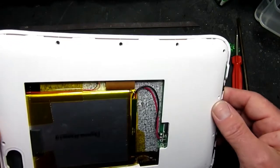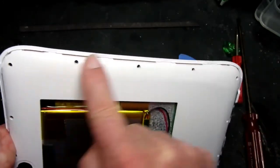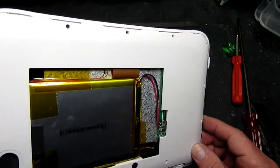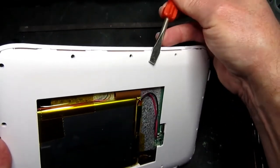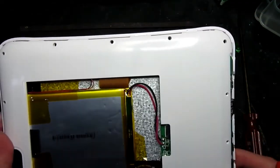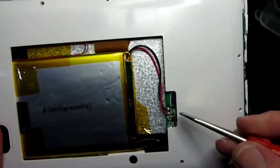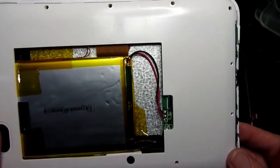The only other advice I can give you is that you have this quite solid back plate in, so that once you get inside the thing you can get another screwdriver in there and start to move that around. Now we need to just verify our thoughts by measuring the voltage across the lithium cell whilst we power it on and see what happens there.